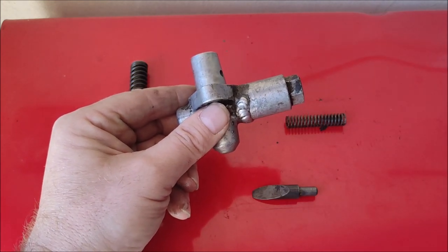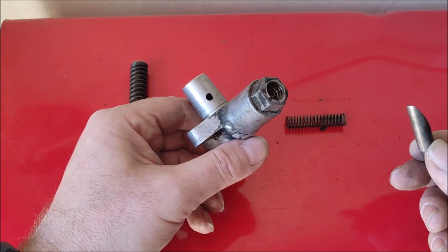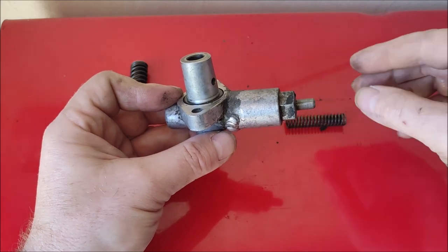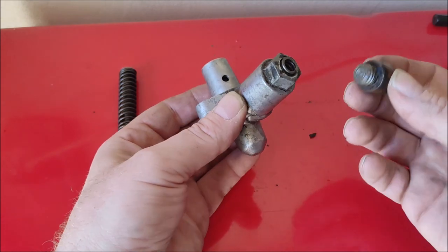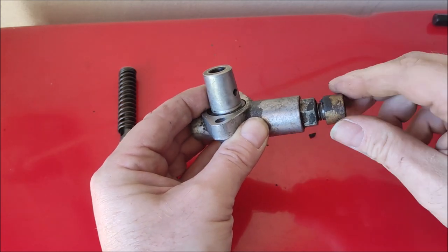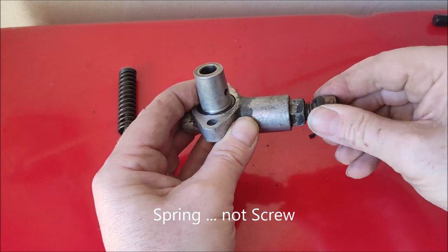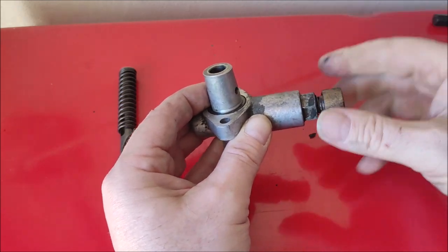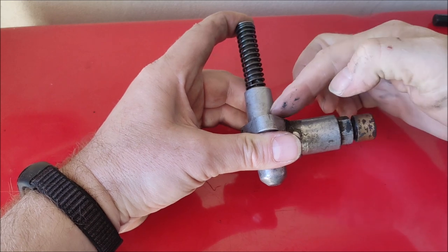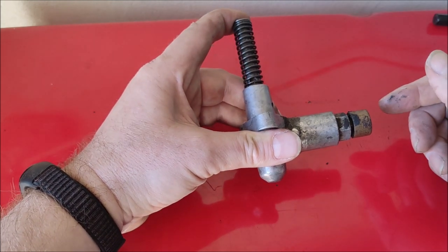What someone's done here — I'm not sure if this is ingenious or not — is they have drilled a hole in the lid and put a thread into it, then welded the original piece on. So this goes in here spring-loaded. What they've done is put a thread in here so that when you thread this end piece in — because the screw normally only comes to the end of this piece — they've effectively put a screw in so that you can preload that spring, which puts more tension on this piece and on the push rod. Effectively, they've created an adjustable cam chain tensioner.